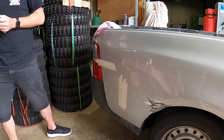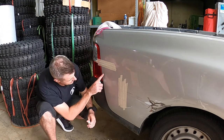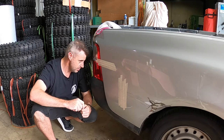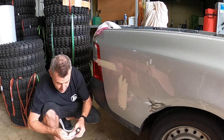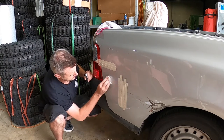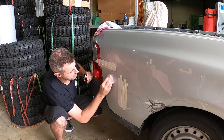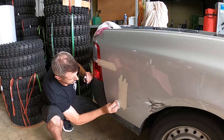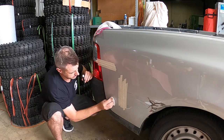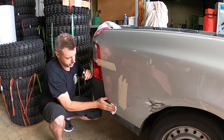So we've just got to do the last step which is the finishing coat. I would say there's definitely a little bit of a slightly more matte finish there, but assuming that was some sort of an aggressive cutting compound that we've just used, this should hopefully get everything looking nice and glossy and shiny again. Now I'm just doing very basic straight motions with both the cutting and the finishing, and we'll remove it going the other way.